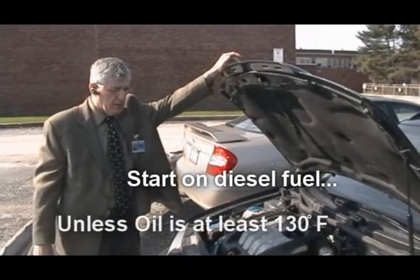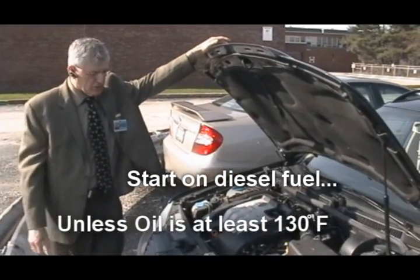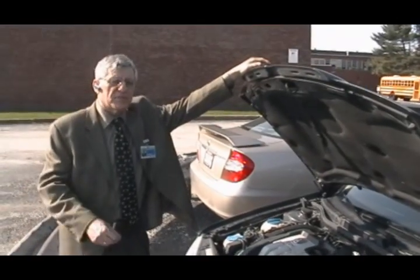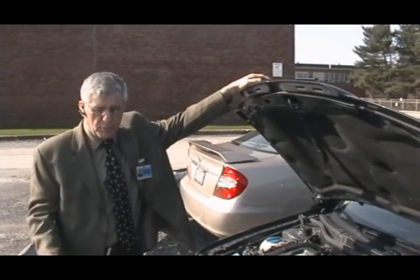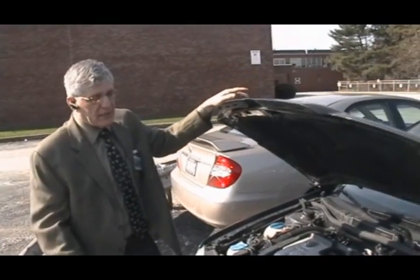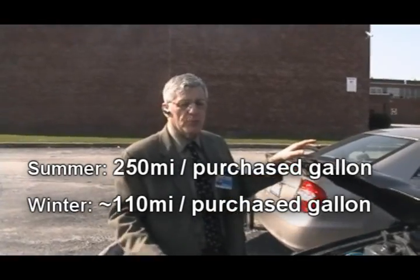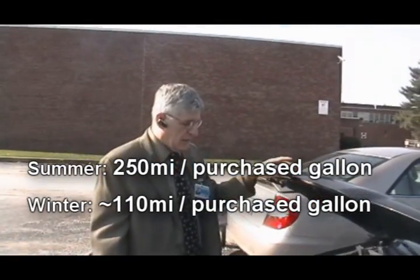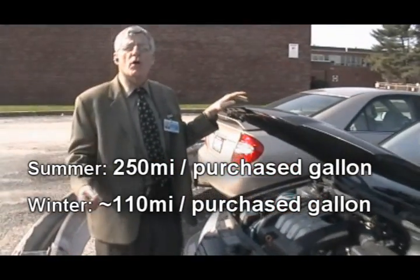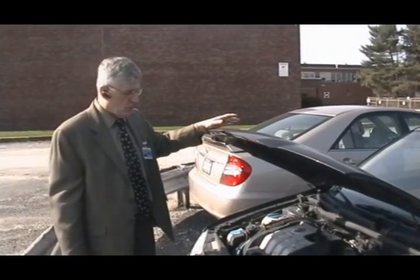This is about my third car that I've been running on vegetable oil — it's a great system. It's free. I get about 250 miles per purchased gallon in summer. In the winter I get about 100 to 115 miles per purchased gallon — it just takes longer for the car to warm up to get to temperature before I can switch into vegetable oil.